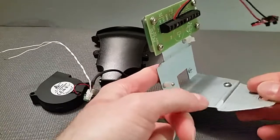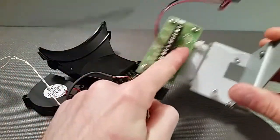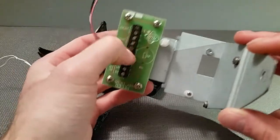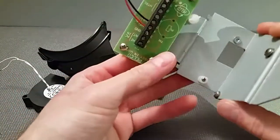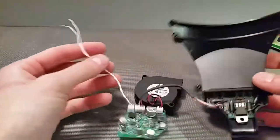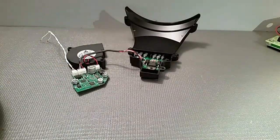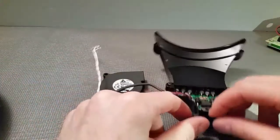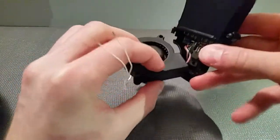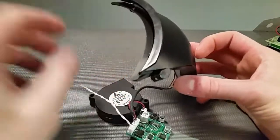It has this kind of bracket here. The blower sits on the back and you have the little air duct with the heaters. It comes here and just blows towards the camera. This here is a repurposed PCB from an outdoor housing — it really doesn't serve much purpose other than as a terminal block. The air duct has these big resistors which act as the heating elements, and this is the little blower. The heaters come on when the thermostat calls for it, and the air is blown out here towards the dome drive. This here is a little control circuit.